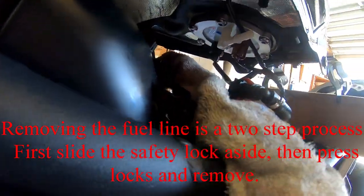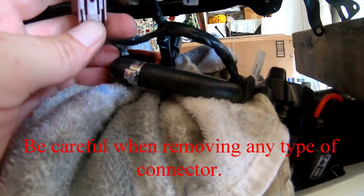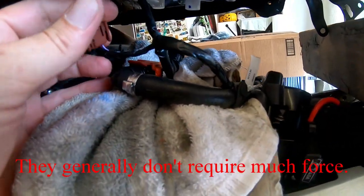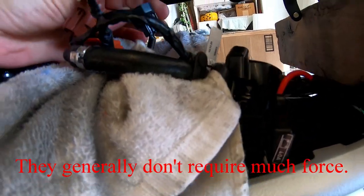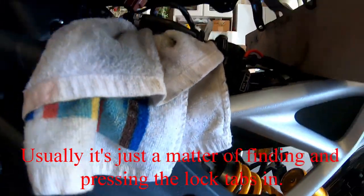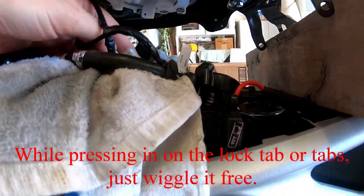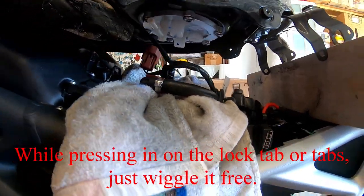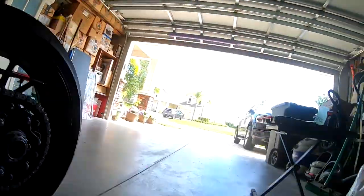Next we go to those electrical connectors. There are three of them. The two large electrical connectors both have a little tab here where my thumbnail is. You have to press in and pull out, and there's one on the opposite side of this one, same thing. One's black, one's brown. Do they look like the same connector? Yeah, so the black one goes to the far side. I'll have to remember that, just in case they fit the same. And there's one more up here, a small one, connected in with a small fastener. Let's get that one out.